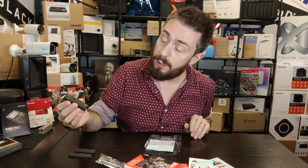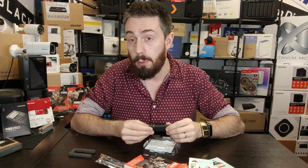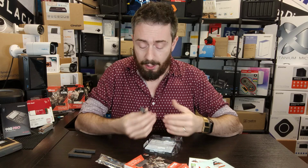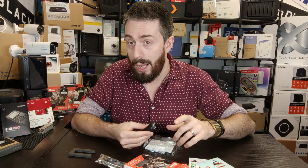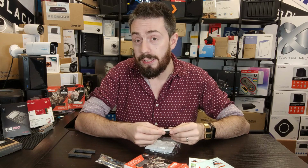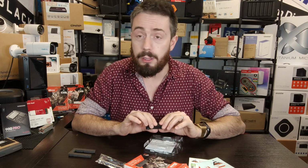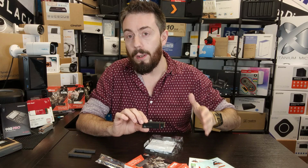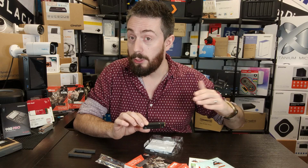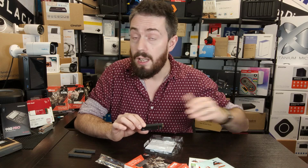This, you're getting the best of both worlds from what I'm seeing, because you're getting a high drive writes per day and higher performance than what anyone else is promising out there. In terms of IOPS, cracking into the millions, as mentioned. And ultimately, it is a much more expensive drive, but the specifications stated do seem to play out. When we did our testing of the 500 gig drive, which we will compare against the 1TB in the test machine in a moment, it demonstrated quite clearly that they were playing it safe with the specifications of sequential write, exceeding it quite impressively there on our test bench.